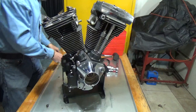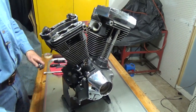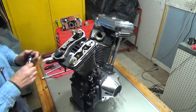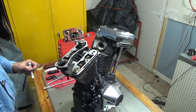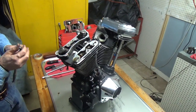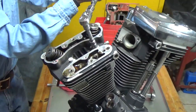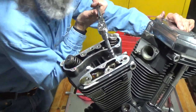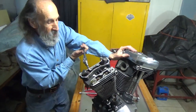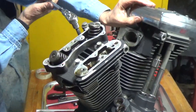Now in order to get the cylinder head off, I like to use a longer-handled ratchet because I don't know how tight these heads are on. You might hear me groaning here in a minute. But they're going to come right off — well, maybe not. Yeah, you want to crack it just a little at a time so that you don't risk warping the cylinder head.